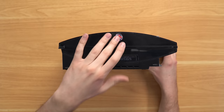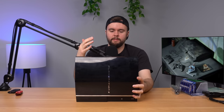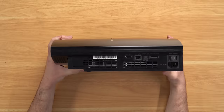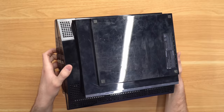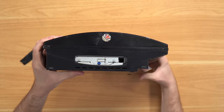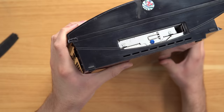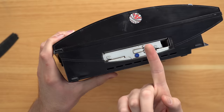There's our cosmetic flaw. On the back, the model number is CECH-E01 — that is the 80 gig backwards compatible model which uses emulation for PS2 and PS1 games instead of real hardware like the A01. But this whole console is just very scratched up. I see a lot of dust ingrained on the bottom — I don't know if they actually cleaned the outside or not. Opening up the hard drive cover — take a look at that — it's just encroached with dust and dirt. I can just wipe my finger across it. It looks like it's been sitting in a basement. It at least doesn't smell like cigarette smoke. We're going to plug this in and see if it works. They actually called this console reverse compatible instead of backwards compatible.